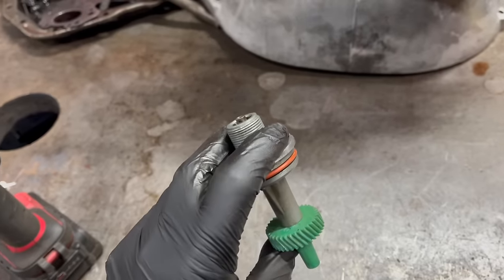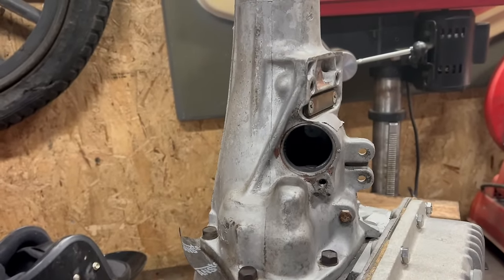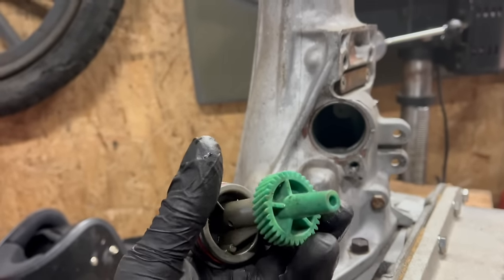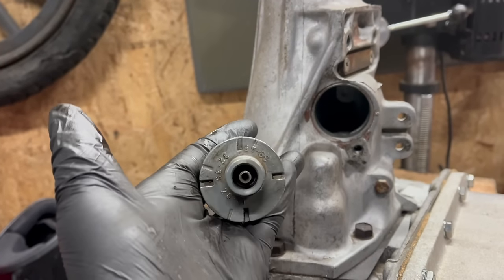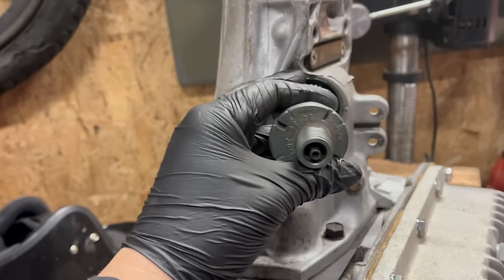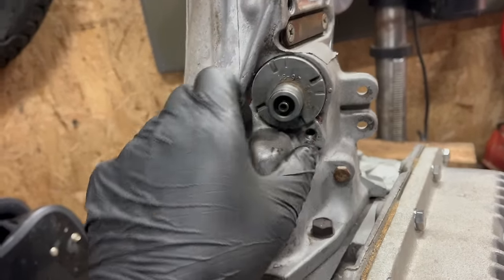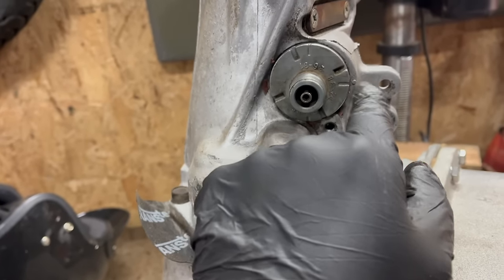They're all the same. There's one very important detail when setting this up. Because there are a bunch of different gears that go in the same housing with different numbers of teeth, but those teeth must be the same size, that means the gears themselves have to change in size. You can see here that the housing is asymmetrical. It's kind of like a cam. You install this thing and then you line up one of the number ranges based on whichever gear you selected, in my case, 32 to 38. That line with that dot.